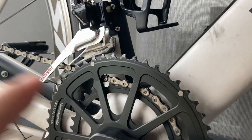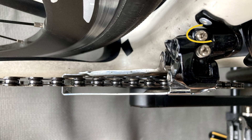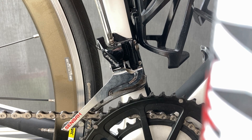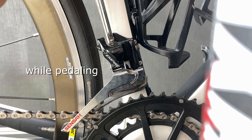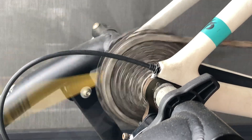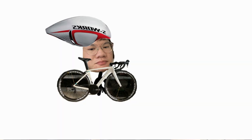If you want to use the big chainring, shift onto your easiest gear at the back, then tighten this inner screw — again, righty tighty, lefty loosey. Now this screw gets quite tight two thirds of the way through, so you have to press down and turn pretty freaking hard. Tighten it until you no longer hear any rubbing noises while pedaling, and you're set to go home. Do note that it will not be perfect and you might hear some rubbing at your hardest gears.